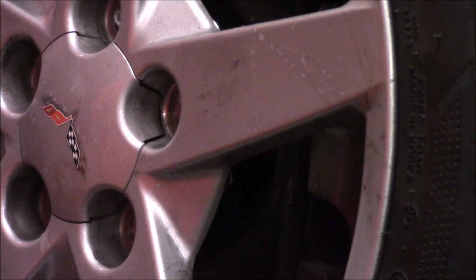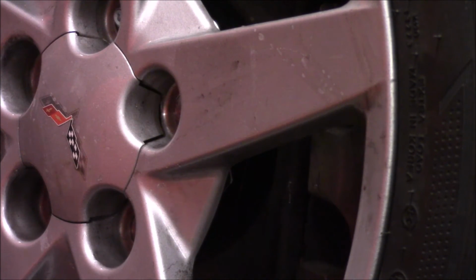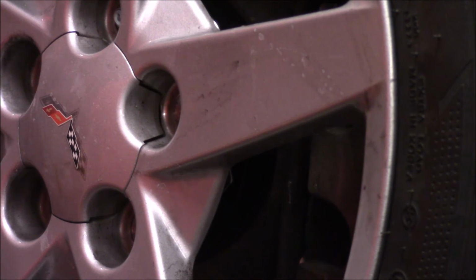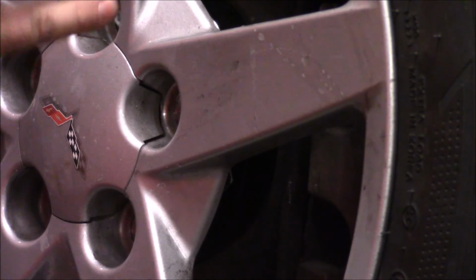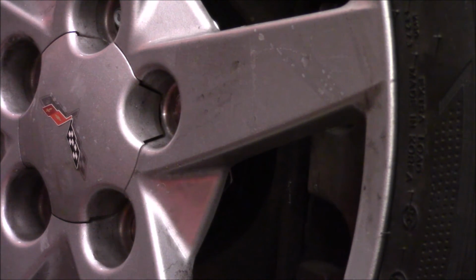I've kind of put up with this in the rears. The right way to do it really is to machine down the OD of the spacer hub, or I guess you could bore out the inside of the wheel, but if you go to use it in the future on a different car, you're going to have a little bit of play when installing the wheel. So I'd always rather modify the part on the car than the wheel, because if you use it somewhere else, it may cause you some issues. So let's get a couple lug nuts on here, hand tighten them, and see how she fits.